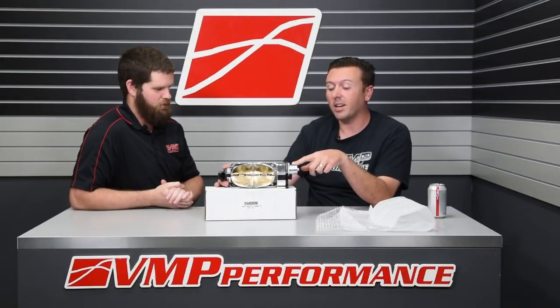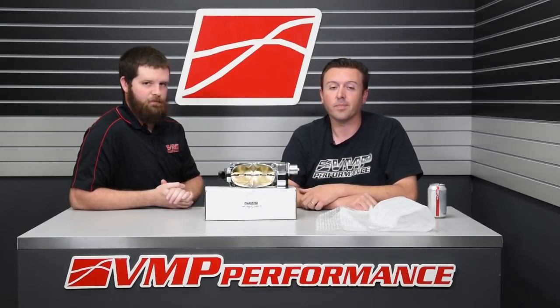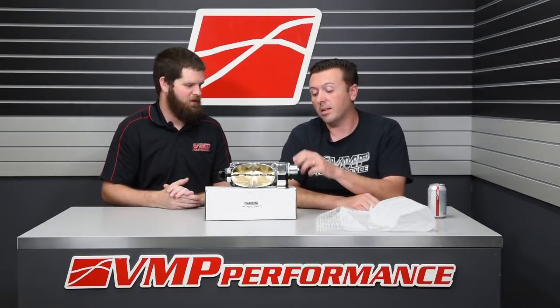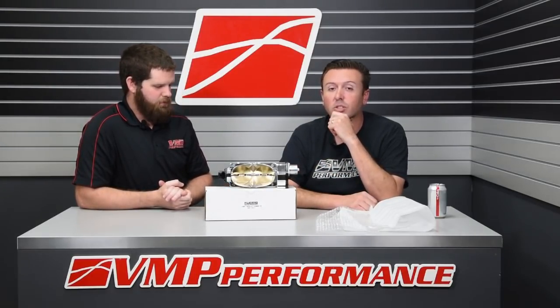If the throttle body works fine at idle and wide open throttle but surges, that is always a tuning issue, a vacuum leak, or usually a mechanical or tuning issue. The surging when the blades are going like this is simply the computer inputting commands because it doesn't have the proper tables to reference. It's trying to go closed loop on an airflow value that it can't find. It's flowing significantly more air than it thinks it should be. We'll have these on the website later this week for purchase.